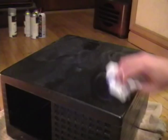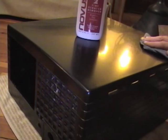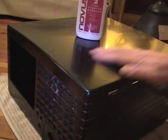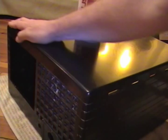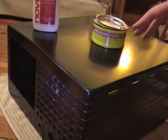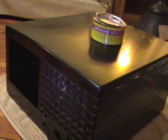I finished two more rounds with the Novus No. 2, and I've got a nice smooth semi-gloss finish. I could stop right now and be perfectly happy — it looks a heck of a lot better, perfectly respectable, with a nice reflection. But I want to go a little shinier, so I'm going to use one last product: Simichrome. It's designed as a metal polish for chrome, brass, aluminum and so on, but I've discovered it works quite well on Bakelite. It's a slightly finer grit than Novus No. 2, so a little bit shinier. It's a kind of pink liquid — like Pepto-Bismol — and it separates a bit when sitting a while so you need to stir it up.